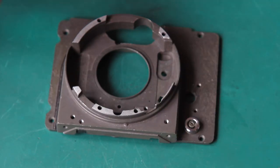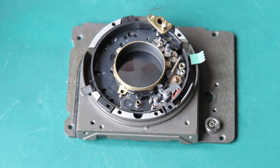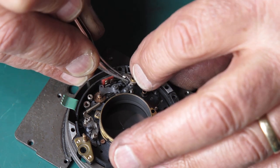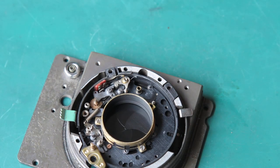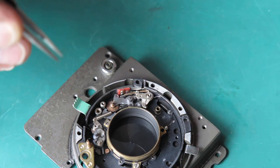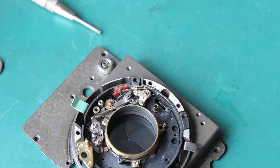Here's my assembly check — let's pop it back in. Next, the flash stuff. I just gave it a very brief quick wipe with molybdenum paste. This spring has to be pulled in against the inside edge of the case — that's what tensions it. Swing that arm out and that should drop into position. And the moving flash contact — that goes in on top of that. Get that seated correctly — that's good. If I cock this, that brings that over so I can get the next lever in place.